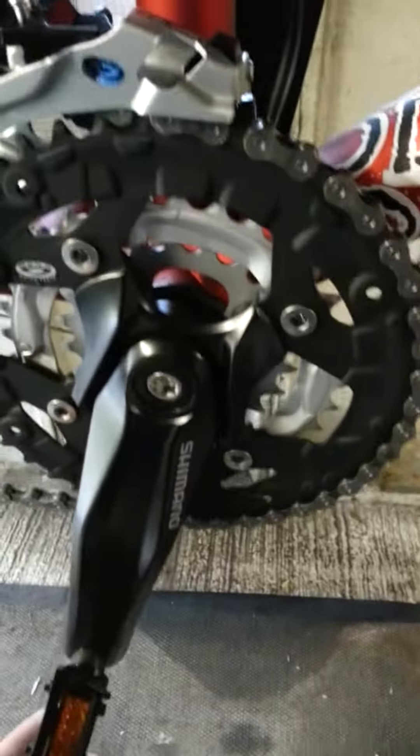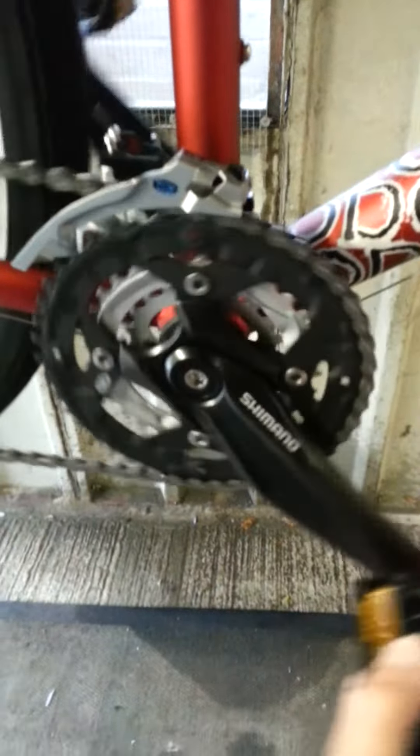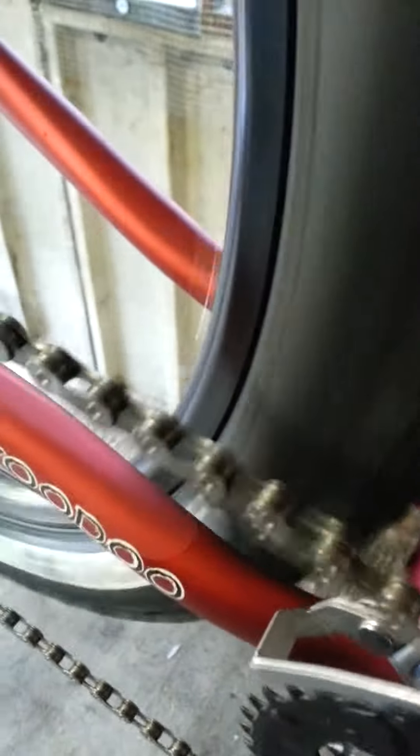To start with, we can see the setup Halfords have done. The front derailleur — we can quite clearly hear it catching on the top of the chain. When we try downshifting onto the bottom cog, the front derailleur just comes totally off.